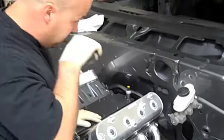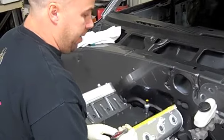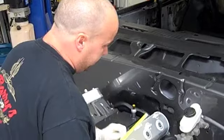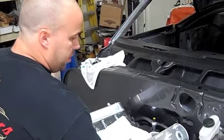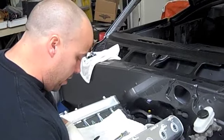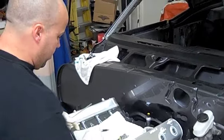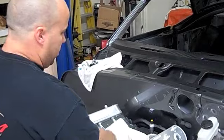What we're going to do here is finish up the top side of the brake lines — measure from the master cylinder back, and that's what you see. Take a few quick measurements and start bending up the top side of the brake lines. We measure back about an inch and a half to give room for the sleeve and the actual flaring tool, then start the bend right there.